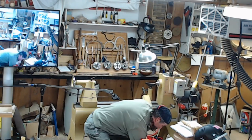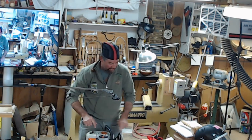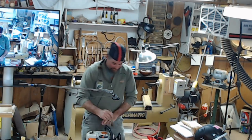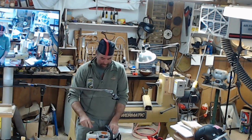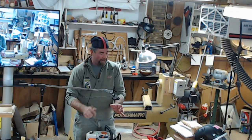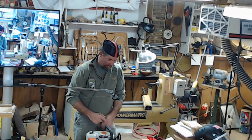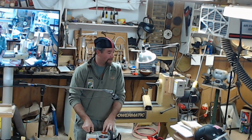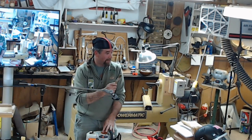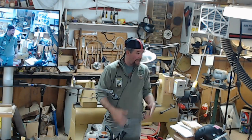On your saw with maintenance, another big thing is every time before you clean and open these caps to fill them up, get an old paintbrush and just brush stuff around them. Especially with the newer caps. The older ones used to be recessed and it was really nice. You could take them off and had a lip there inside the cap where nothing fell into it. Now with these new caps, everything gangs up right here and you can't clean anything. So as soon as you go to move the cap, everything drops right into the saw. So go buy a cheap paintbrush for 99 cents and just brush them off the best you can and then wipe them down, especially afterward.